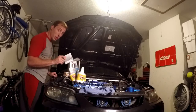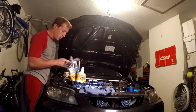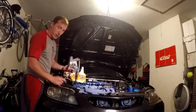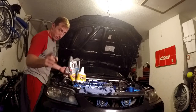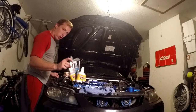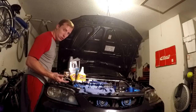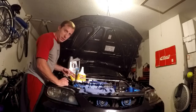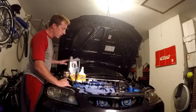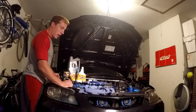We are also going to be changing the spark plugs because this particular car seems to like copper plugs. I've used these before in my last two Proteges — they run real good. These are the long reach plugs; the NGK part number is ZFR5F11. You can verify that. They're a little bit longer reach plug, the spark gets in them a little bit better. I know most people say spark plugs won't change the way a car drives, but these plugs have made a big difference in this car as far as idling and smoothness.